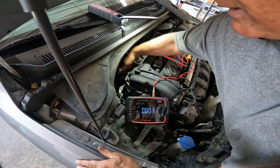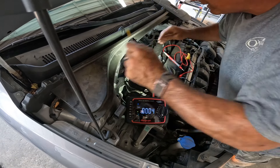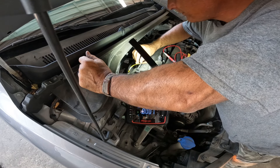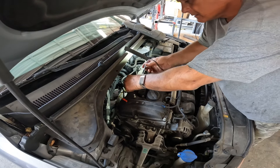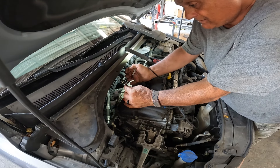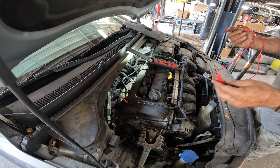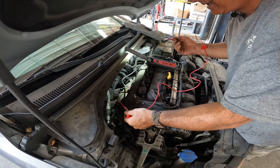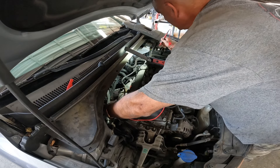I'm going to hook a ground and a hot side to this and see if I can activate this solenoid and feel it click off and on. Let's get some jumper leads hooked in here — black on the ground side. When you do this, make sure you check orientation: it plugs in so the orange wire is to the left, and the control wire is to the right. I'm not going to hook up the hot side permanently — I'm just going to tap it off and on.